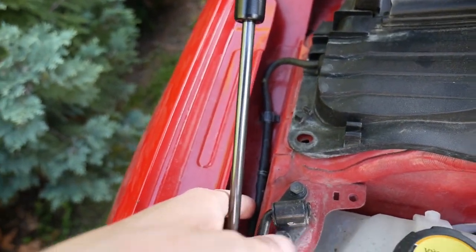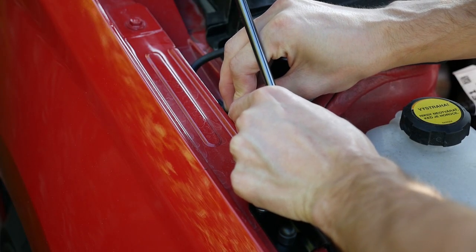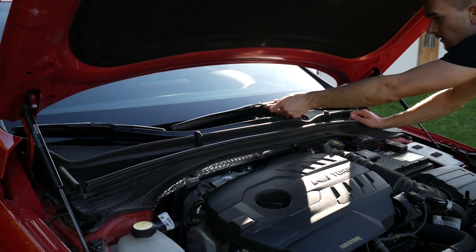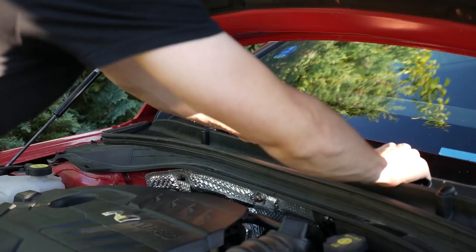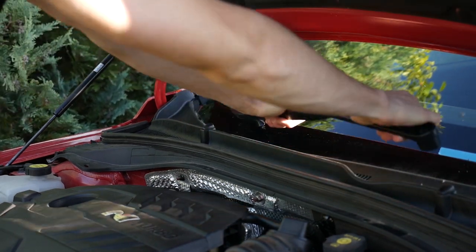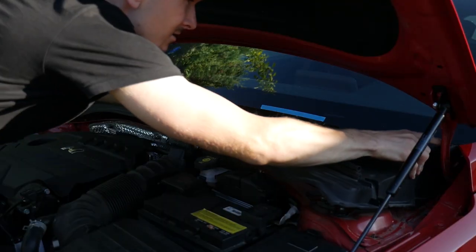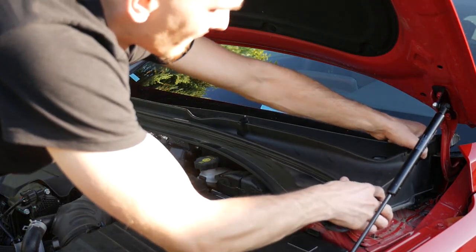An essential part is also the removal of the wiper hose, where we don't have to worry about using force, we only have to pull one hose from the other. The first wiper, or the shorter wiper, is detachable when it's angled to 90 degrees, but the longer one does require brute force, so don't worry if you won't pull it out on the first try. The cowl top is loosened now, but snapped to the sides, so it has to be detached at those spots, so you can remove it completely.